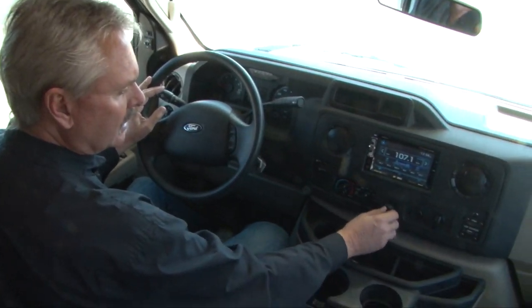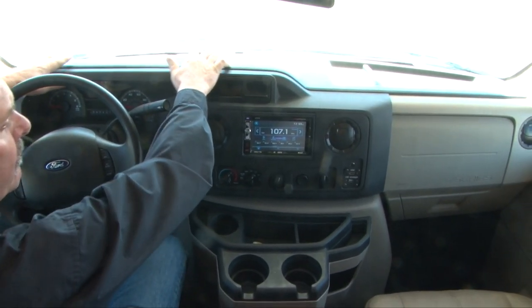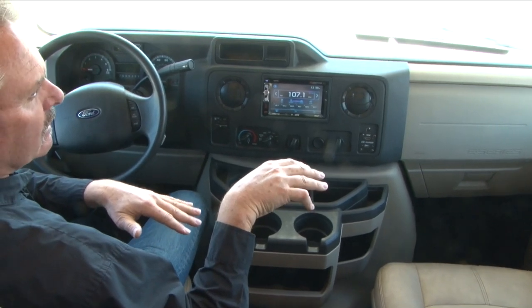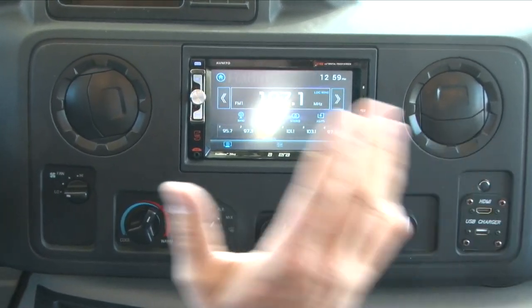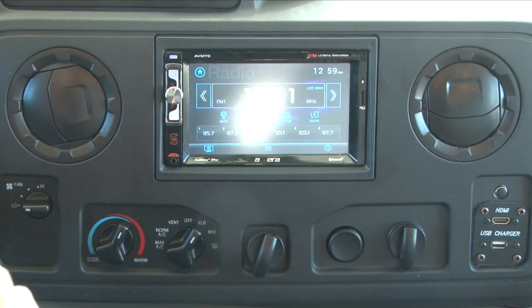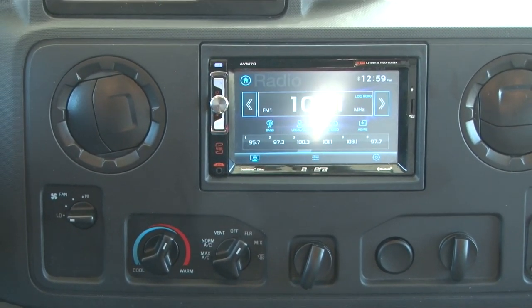There's a couple of outlets here to charge phones. These are all run off of your car battery. You have a car battery to start it, and you have two house batteries. We upgrade everything to dual house batteries for you. And those will run everything in the back except your microwave, your air conditioner, and your outlets. We'll get to that when we get back to the generator.